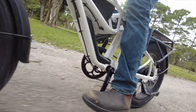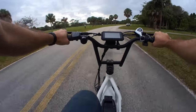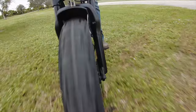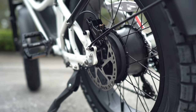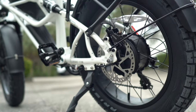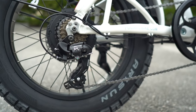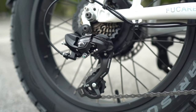Suspension aside, the rest of the bike seems pretty decent, though I'm not without complaints. The pedal assist lag is atrocious — sometimes a full two seconds before the motor kicks in if you're on pedal assist only — but I can just blip that throttle when I start pedaling, and that gives me instantaneous power. Then there are the disc brakes. They are hydraulics, which is great, but they just aren't as bitey as I would have hoped, probably due to some cheaper brake pad compound — something you could swap out if you were so inclined. And lastly, the Tourney derailleur isn't exactly top or even mid-shelf. It's probably fine since this is not a high-end e-bike, but note that you may need to do some occasional tuning on your derailleur if you like to pedal and actually shift gears a lot.